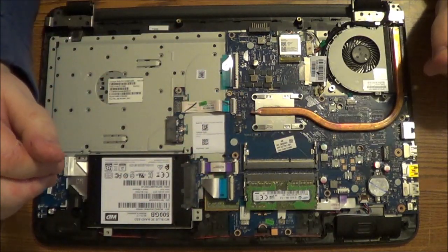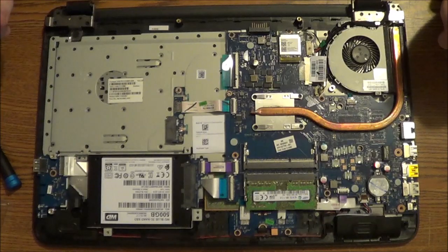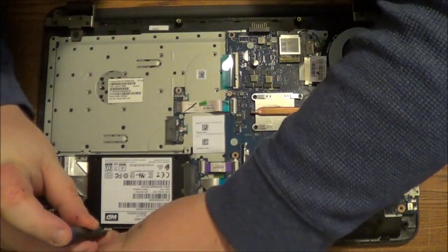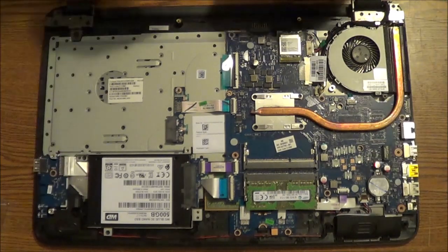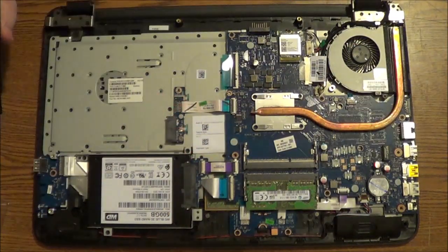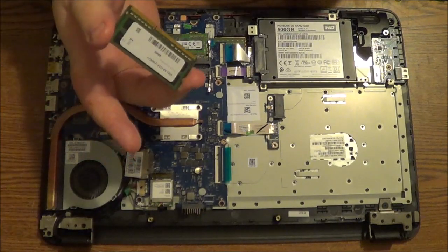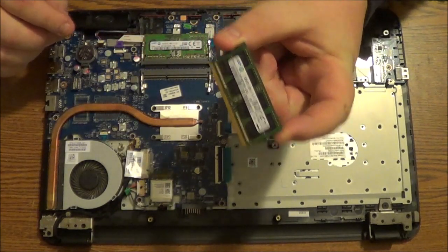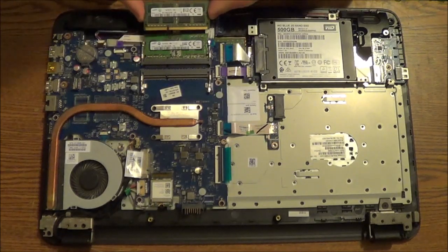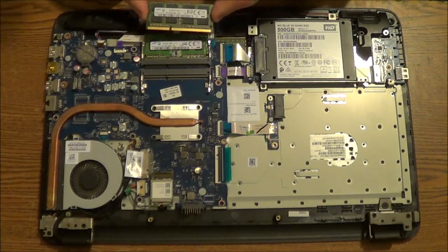Remember, don't touch anything on this board. You want to make sure that you're perfectly grounded to prevent any kind of static buildup. You can then simply remount the drive. Make sure that you do thread the screws in hand tight. Now you want to take the memory module — you don't want to touch anything on that board, nothing. You'll notice that the two memory modules look identical — this is what you want. You want them to have the same speed and the same process. They have to match for this to work.